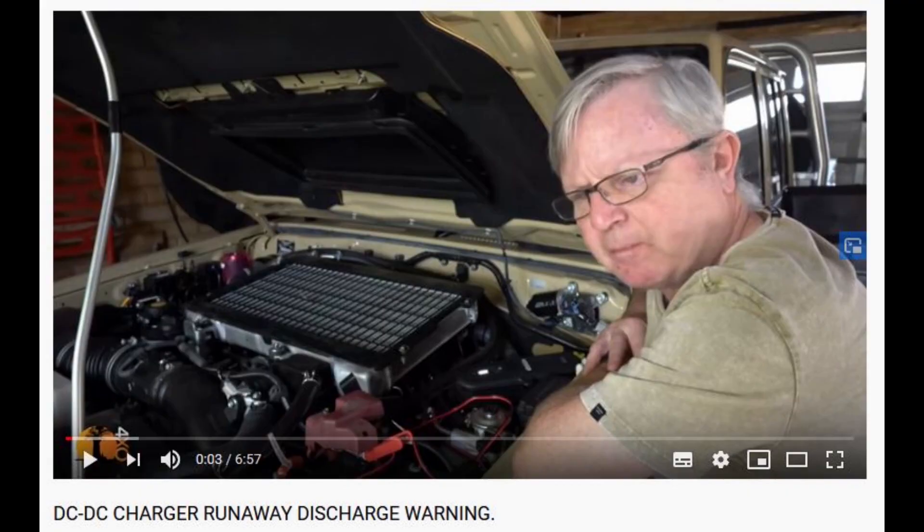This charging unit has certainly proved to be completely reliable so far, but it's early days. There is a little story behind this: one of the experts who strongly recommended the use of a DC-to-DC charger found to his cost that his much-vaunted Redarc unit had an alarming tendency to flatten the main battery whilst charging the auxiliary battery — the very thing which it should never do. In his case, fortunately, it only happened in his garage a couple of times, but it would be much more serious if he'd been in the middle of nowhere on a long trip.